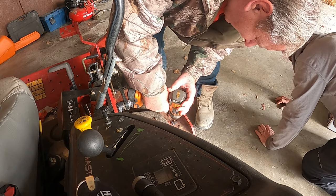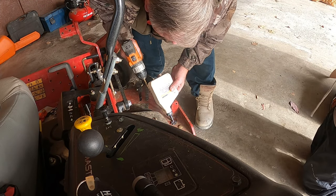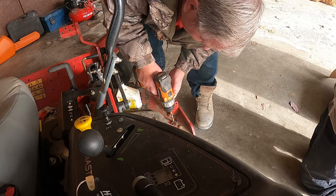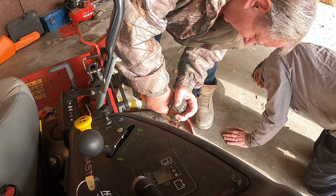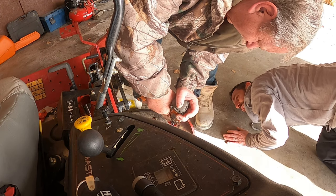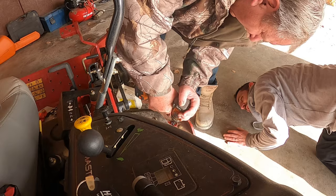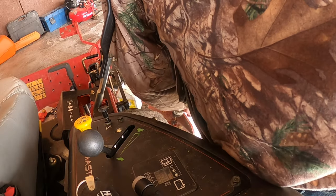At one point I'm underneath just making sure it's getting through, and there's a baffle that it was close to in the first drill. And then the middle was completely clear. And then the one other end that I didn't record video, there was a little bit of a plate where you can control how you want the baffle to open and close, more narrowly. The bolt rubbed up against that adjustable plate, so we just had to drill a little bit of that plate off so the bolt could slide free.